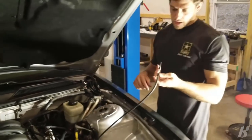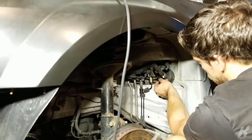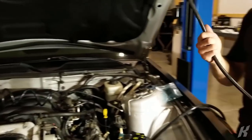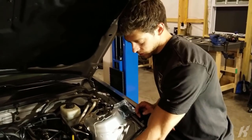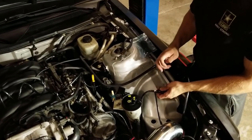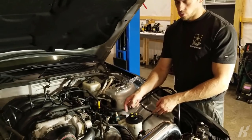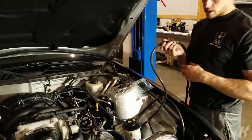This is the line for the boost controller. Blow off valve line. We got coming off the compressor housing, a line that goes right here, and then tees. One line goes to the controller solenoid, boost controller solenoid. The other line will go down to the wastegate.